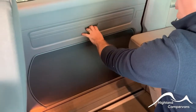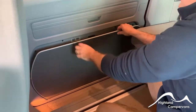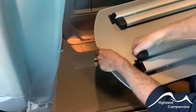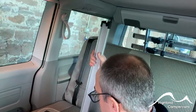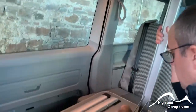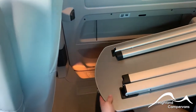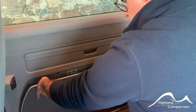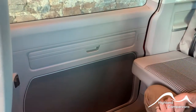For the table, which is used in conjunction with the chairs from outside, there's a release lever that you pull up. With the sliding door shut you should be able to lift the table out quite easily, and then each of the legs comes out and locks into position. Push down on those tabs again to fold it back. Make sure you've got the little metal bracket at the top - load it into position from the base first and then press it firmly back in.